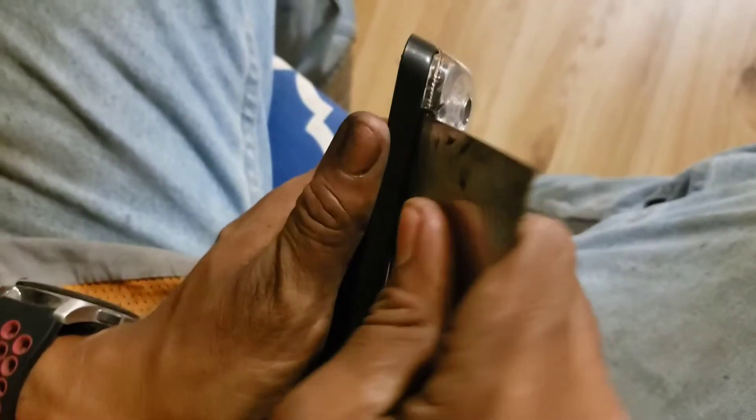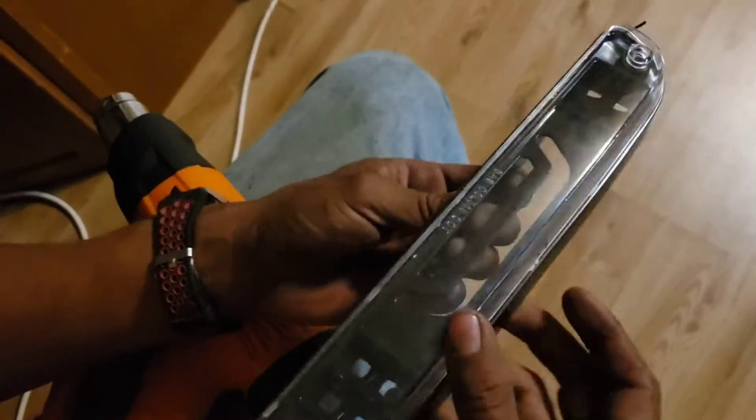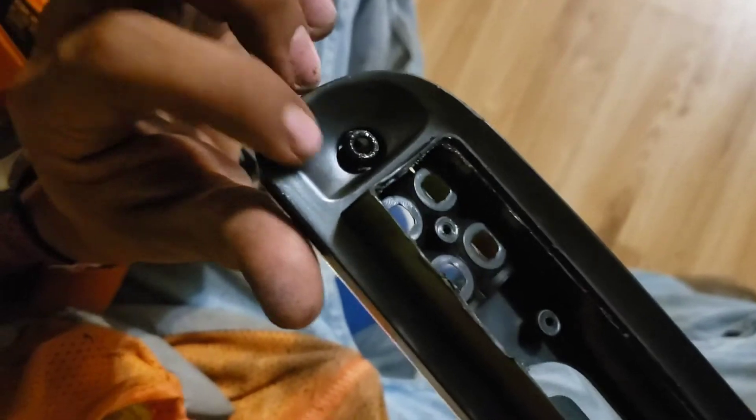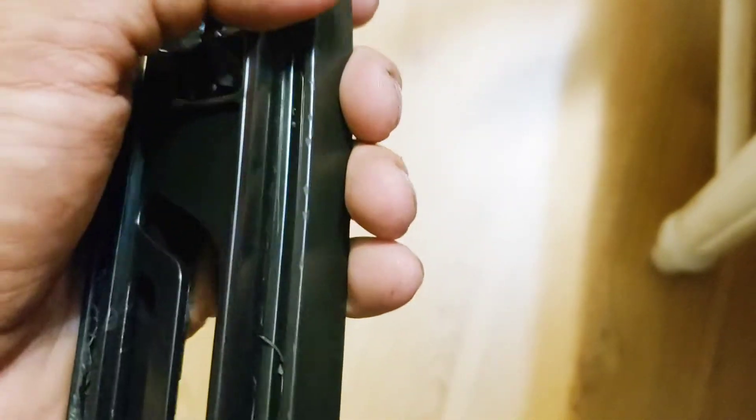In and out, in and out — you can see that stuff peeling right up. I'm going to heat the rest of this up; I don't want to pull it and crack the lip. I'd recommend hitting the heat gun back here rather than the front. If you shrink or crinkle this lens you're kind of screwed — if you crinkle it like I did right there, that's too much heat. Oh well, it's in the back, you can't see it and the screw still goes through. This is the face of the light — try not to mess with it, keep your hands clean and use a microfiber rag.